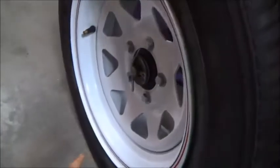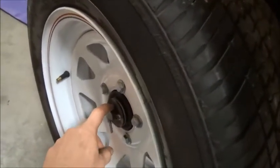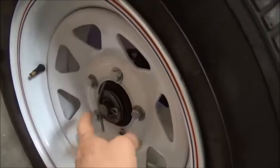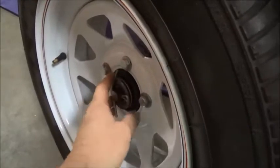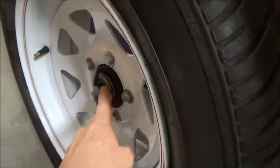On my previous video of the steering, you saw me make all this stuff. I had just put a couple of little C-clips in a groove on this axle shaft right here. So I did the same fix — I drilled a hole through the axle and put a big pin through it. If I have to, I'll put a quarter-inch bolt with a lock nut on it. I had to do that on both sides. Lesson learned — I'm not going to use C-clips on anything anymore.